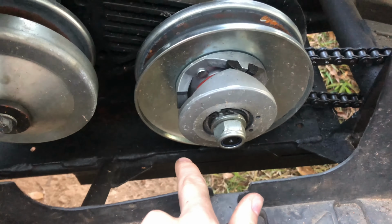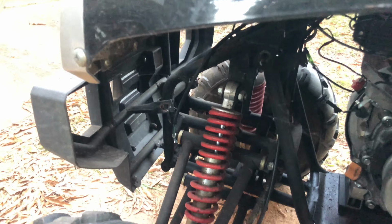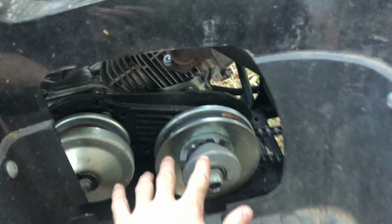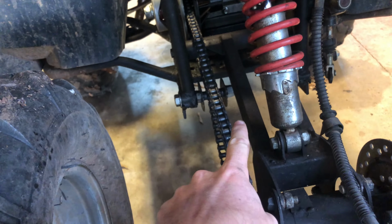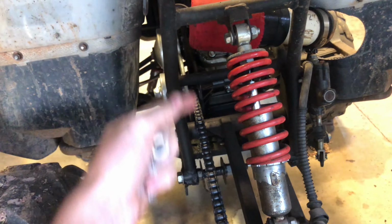It's gonna really weaken it because we had to weld angle iron in this frame. It's just a very, very cheap steel used to weld it together. So that's gonna take away structural integrity. So that's not an option. Basically, I'm gonna have two arms coming out here. The only one coming out here is like a support. I'm gonna put a bolt through it, and I'm just gonna put a spring somewhere right here to keep the chain tight.